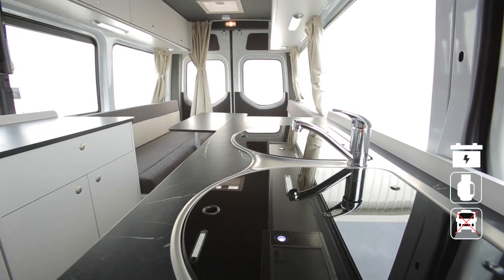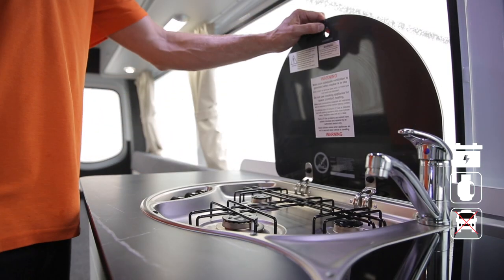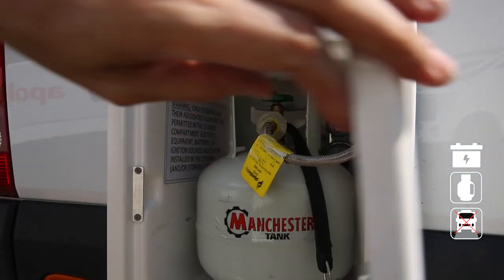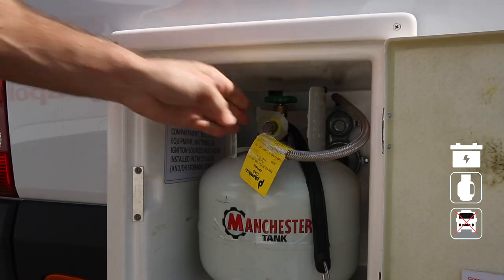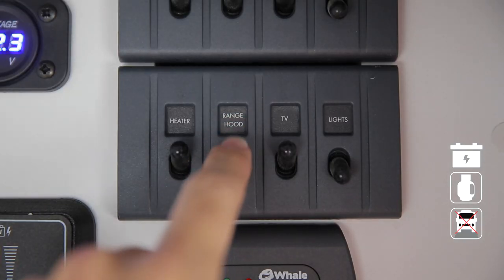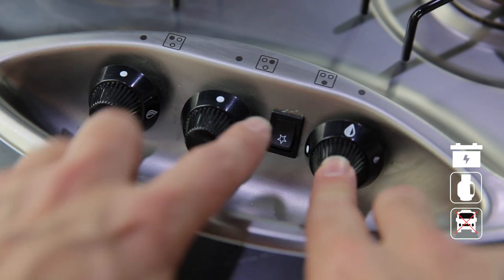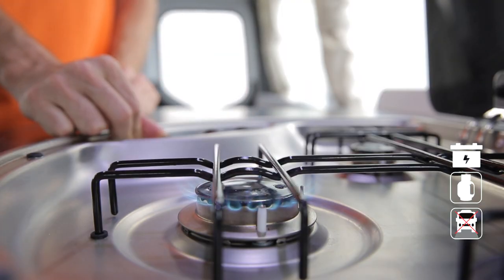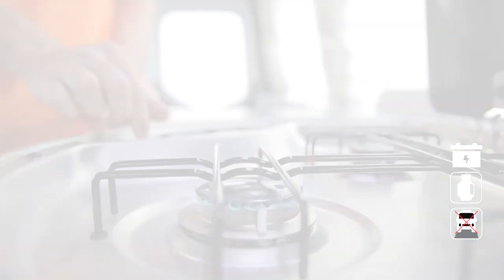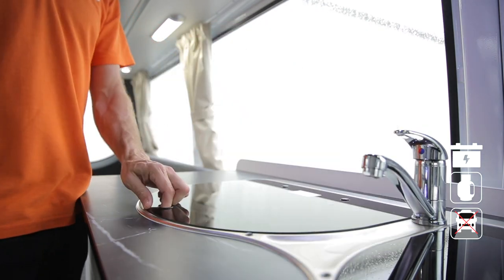When you're ready to cook, your RV has a fantastic cooker with three gas burners powered by the LPG bottle. You'll need to go outside and turn the gas on at the bottle — make sure you open the valve all the way. You must have the range hood on in order to light the stove. To use the gas burners, push and rotate the dial, then hold and press the ignite switch. Continue to hold the dial to ensure the gas stays lit. Once you've finished cooking, wait until the stove has cooled down before lowering the lid.